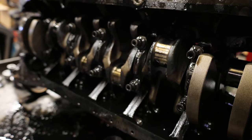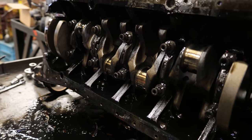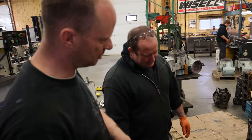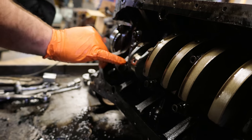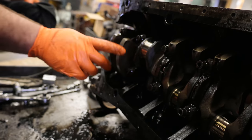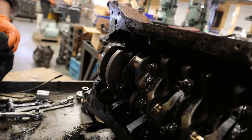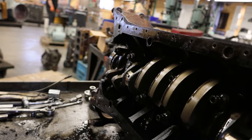25 years old — there's no reason to think this has been rebuilt. Still good quality steel. You can see the yellow tint to the casting — that's usually with the heat treating, but it looks like it's nitrided. You can see the yellow kind of in the actual casting, and the holes are already all chamfered. The block looks like it's in good shape. We still didn't measure it, but we'll wash it — it still has crosshatch on it, so I don't think it needs too much work.